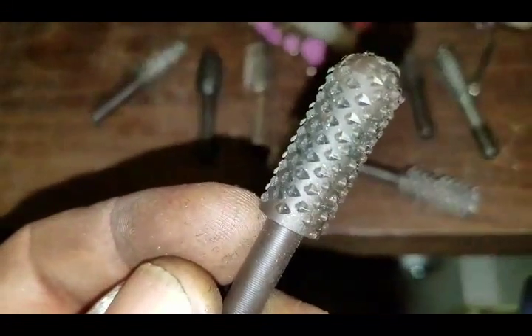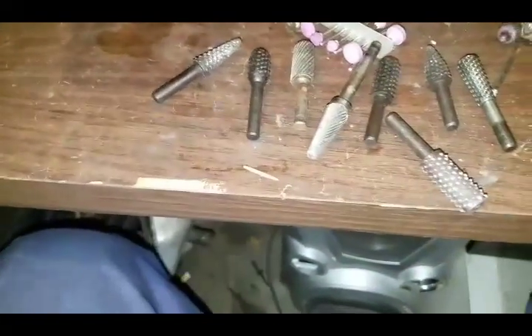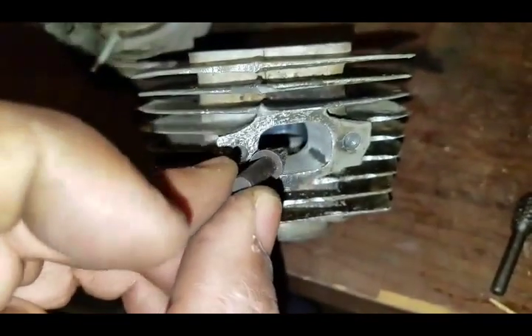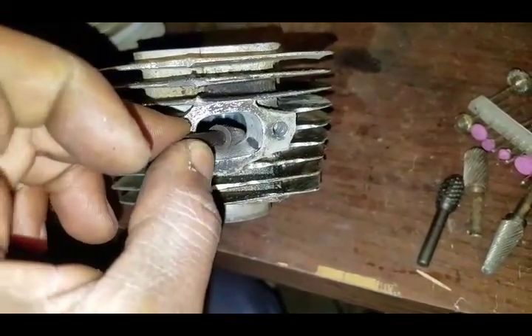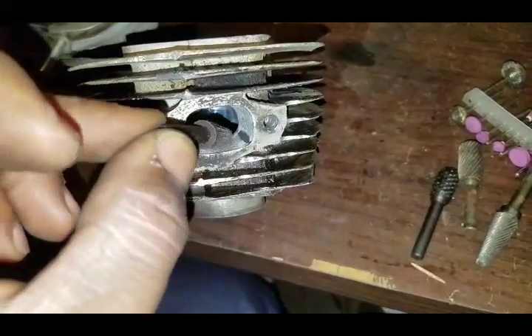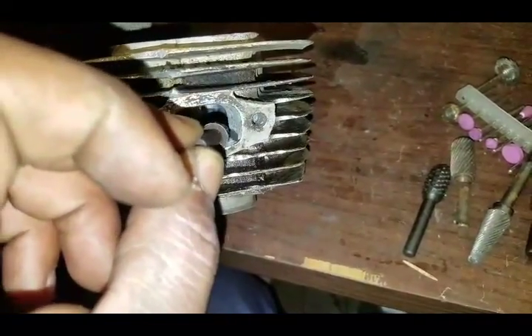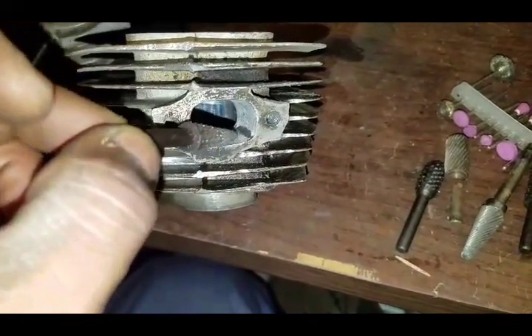Some of these bits here will get you going — that's what you need. You can achieve this with these, but not too much, just slightly. You can chamfer the insides out, but try not to move them up or down because you'll change the timing and the engine might not run, or it'll run poorly. Just widen the outside to match whatever exhaust you're using.